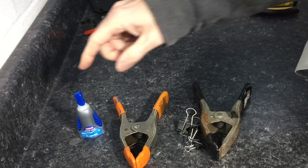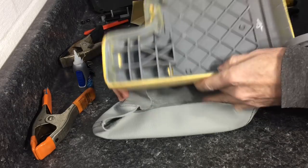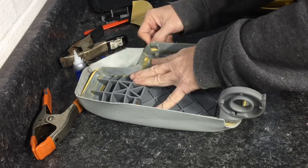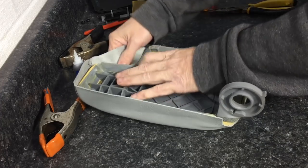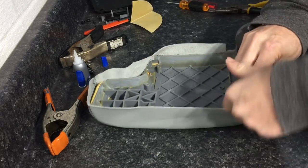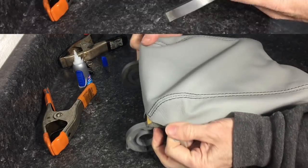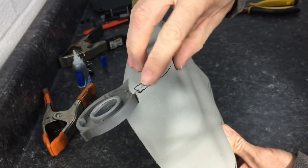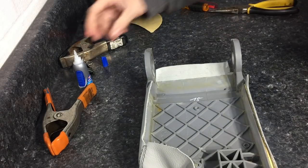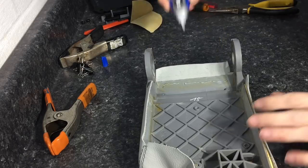Time for installation. All you're going to need is a few clamps — some light duty, some heavy duty — and the Loctite and the leather wrap itself. We're going to lay the leather flat upside down, fit the armrest on top of it, and work on fitment, making sure everything lines up before we start to adhere the leather to the armrest. When I'm satisfied with alignment, we're going to start with one edge and begin to adhere. There's no need to go crazy with the Loctite — just one straight constant bead all the way across the seam.